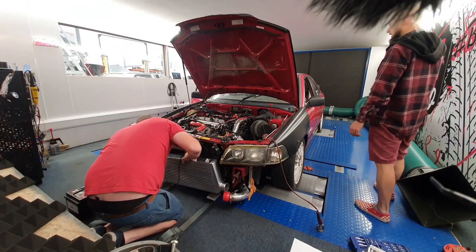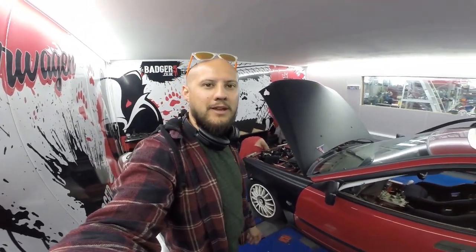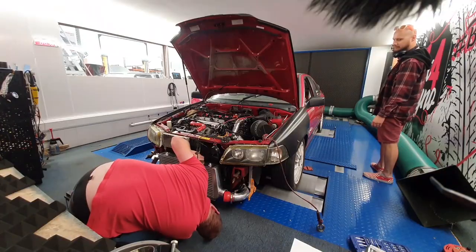Nick is now fitting the new bar-and-plate intercooler and we'll see if that makes a difference to the inlet temperatures. That's basically all we can check on here - see whether it makes a difference with the inlet temperatures. We're not really going to be comparing power against one another because changes are being made. The inlet temperatures shot up to about 43 degrees on the tube-and-fin intercooler.